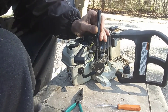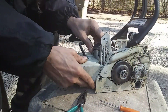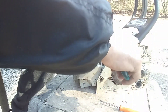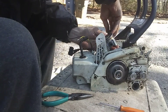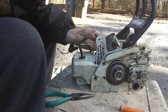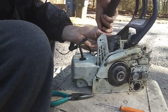You can take your socket if you've got one that'll fit. See the wrist pin coming out — get you some needle nose. It ain't wanting to come the rest of the way out. Give it a little bit more persuasion. This is probably the toughest part of this whole job: taking this out and putting the new piston on with the wrist pin clips.